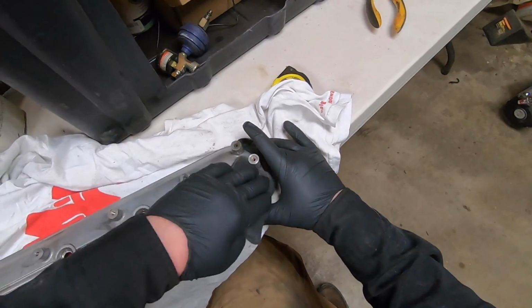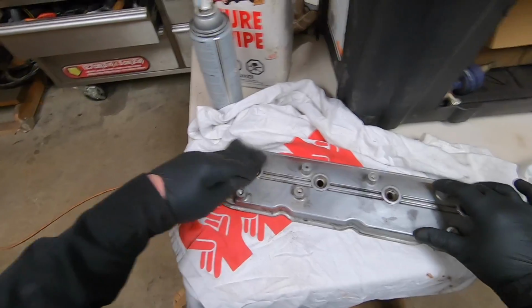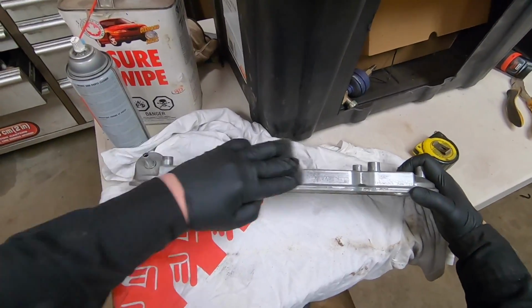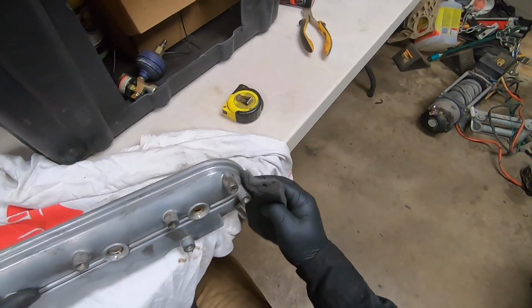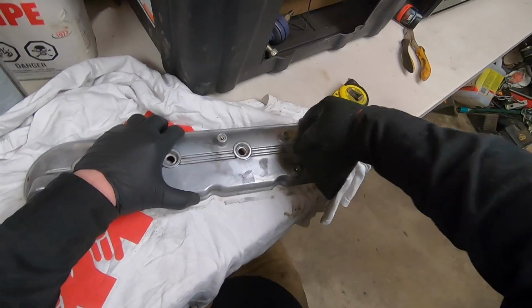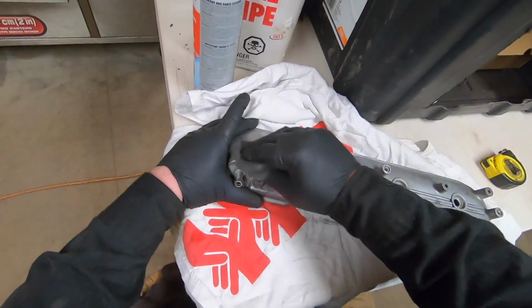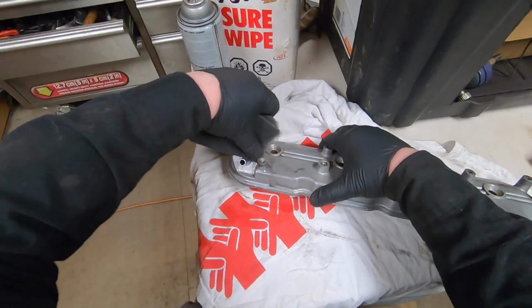and hopefully get some of those oils and that off, and then we'll clean and repeat a few times. We're spraying her down again. Start scrubbing her, especially the sides. That oil and grease gets stuck in every little cavity, every single little cavity, and it'll come back to haunt you every time, especially when you go to put the powder coat on it and you go to bake it, and you're gonna realize that it's probably gonna bubble and look terrible.